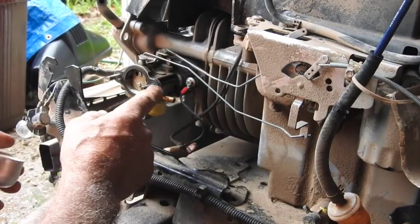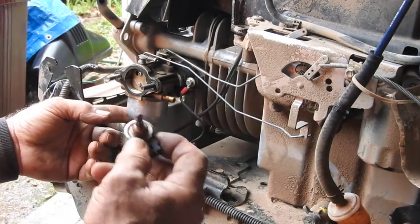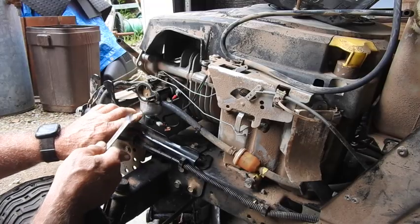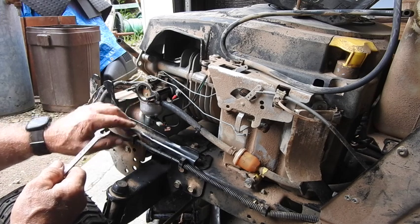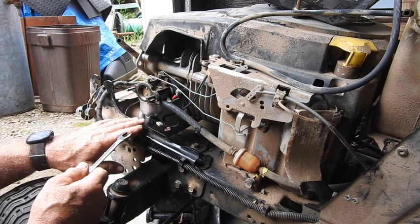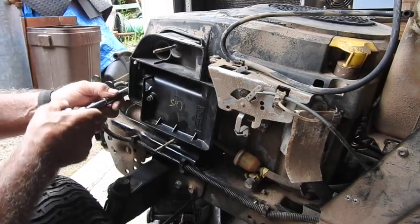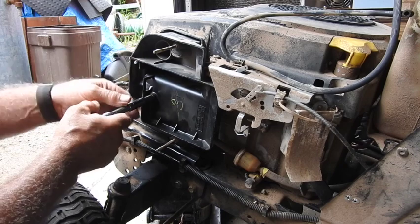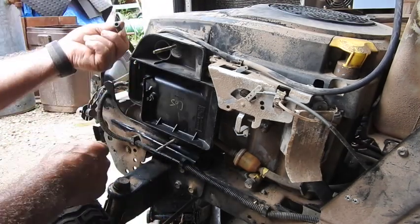Assembly is just reverse order of disassembly. The most difficult part is always the linkages — you have to make sure you get those in without doing any damage. The solenoid actually threads up in here and is the bolt that holds the float bowl on the carburetor on these new ones. The only thing that keeps the bowl from leaking is tightening up the anti-backfire solenoid into the bottom of the carburetor, compressing that gasket at the very top. Make sure you snug it up until you don't see any leaks. These two nuts secure all the gaskets up against the engine and on the back of the filter — get those snug but not crazy tight. Then your gas tank vent and this vent here go back on.